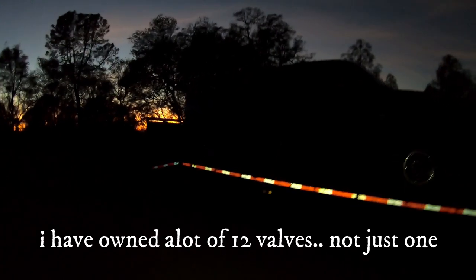Definitely wouldn't recommend towing full time with a single wheel 2500, even if you do have overloads. That truck gets pushed around pretty good in the corners when you shift. All the weight and all the load of the torque of the engine lets go a little bit when you push in the clutch. You can feel that trailer pushing on the truck. You'd have to be in the truck with me, I guess, to really tell what it is.